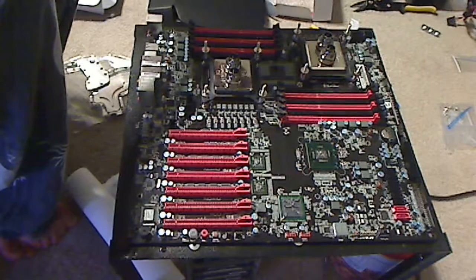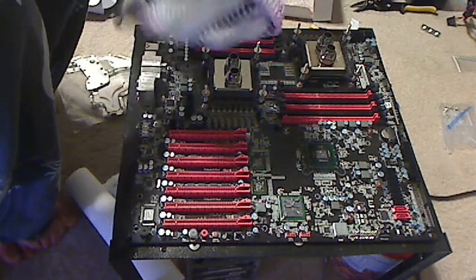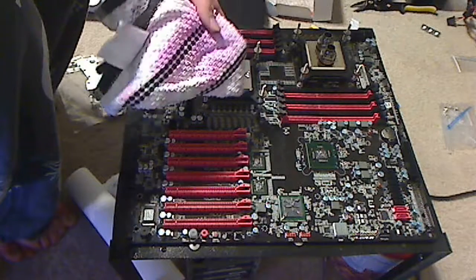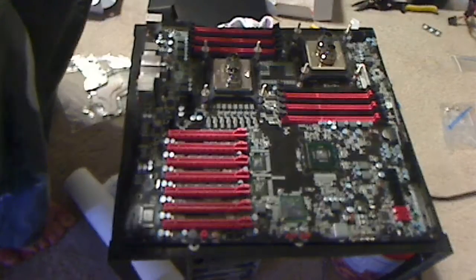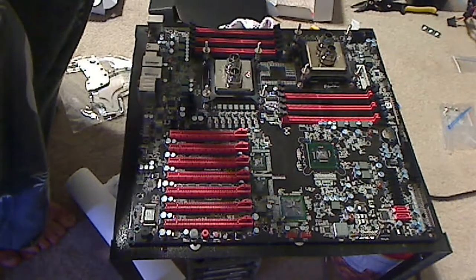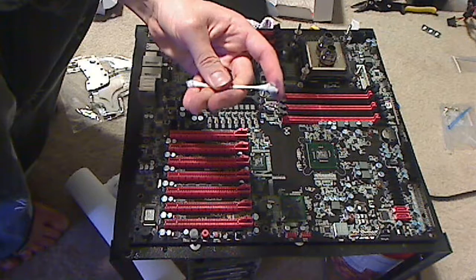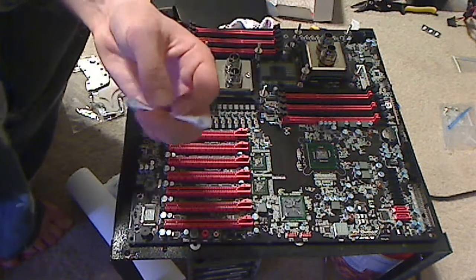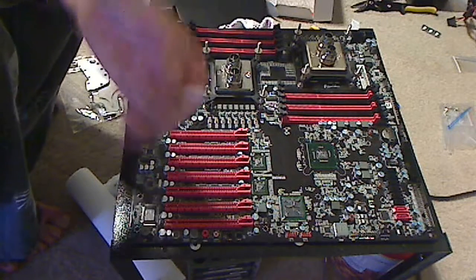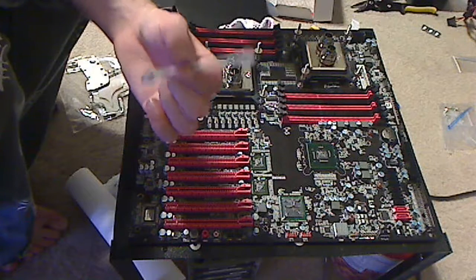I have this to remove paste, and I've got a little bit of coolant that I've lopped up from some of my other systems, and some Q-tips. These are not the best Q-tips to use — you should use the ones like the makeup ones, without the huge cotton swab at the top. A little bit of alcohol. Be careful with alcohol if you're going to use it. Make sure it all dries off, because if not, you will short-circuit your system.